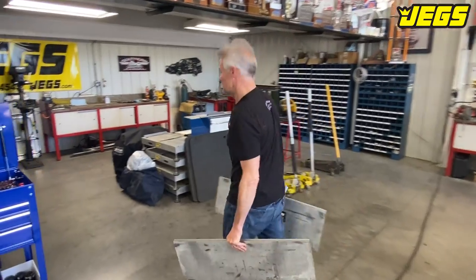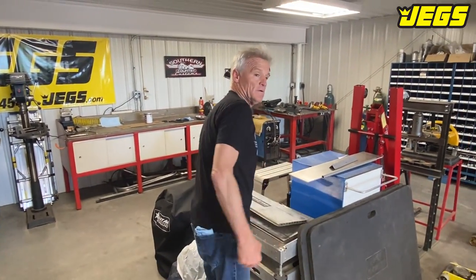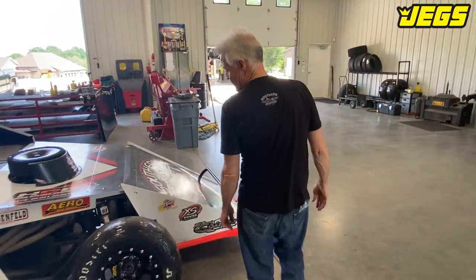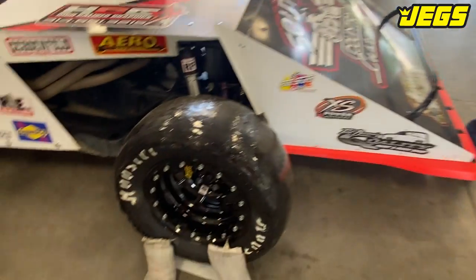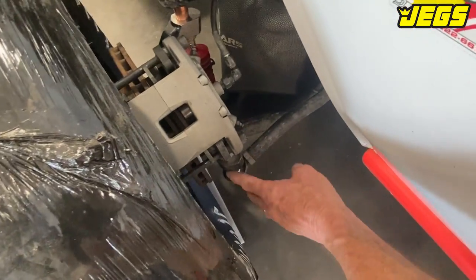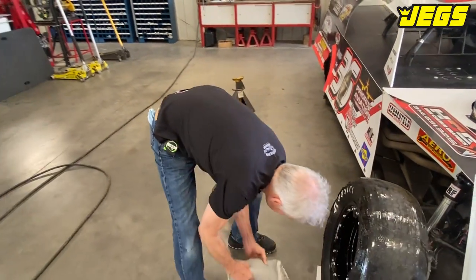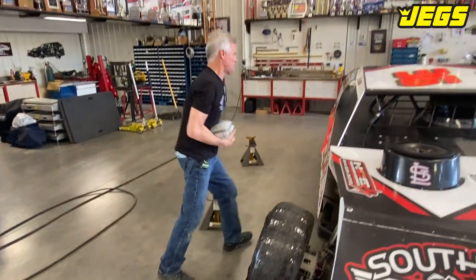We got lucky. So, you know, sometimes when you start a video like this, you don't get lucky. But if the toe was not right, I would have come right here, and I would have loosened this nut. I would have loosened that nut, and I'd have taken that off, and I'd have adjusted that heim right there. But I'm happy with all that. So put this back.